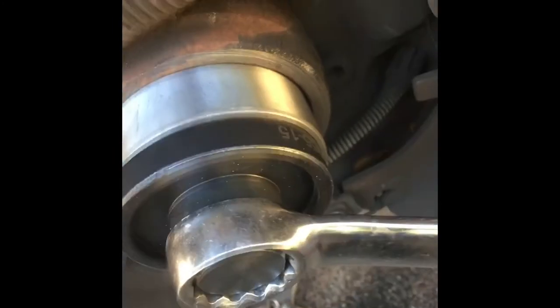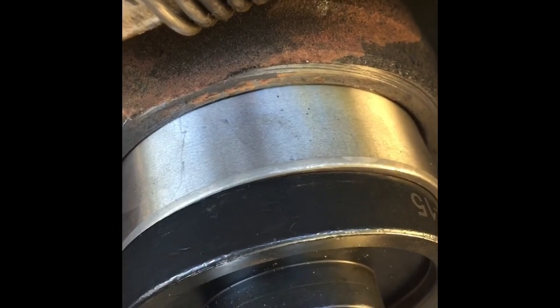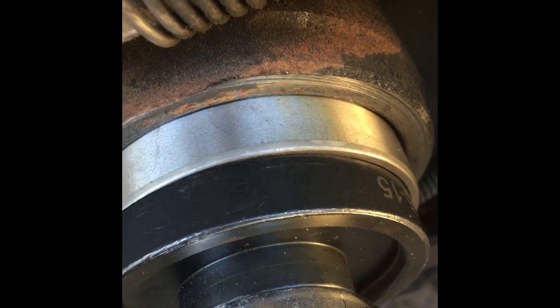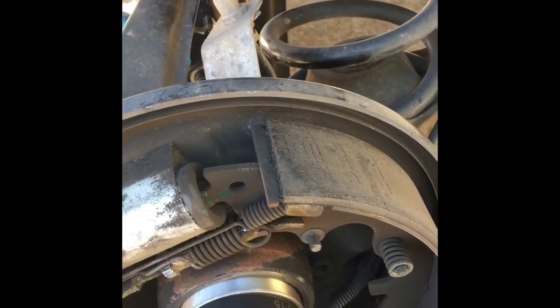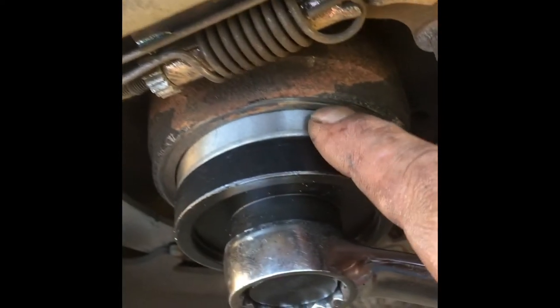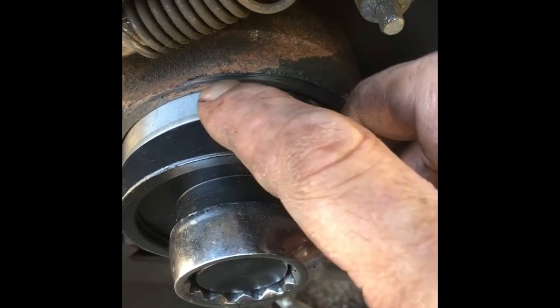Now, if you're fortunate enough to have a drill that's got some power behind it, he's going to tighten that nut, and I'm just going to hold this still right here. We're going to watch that suck in. All right, go ahead. Now, you only need to do that till it feels like it's getting tight. And then after that, you'll have about this much room left. Then you want to start doing it by hand. We really don't want to use vibration and damage the bearing.